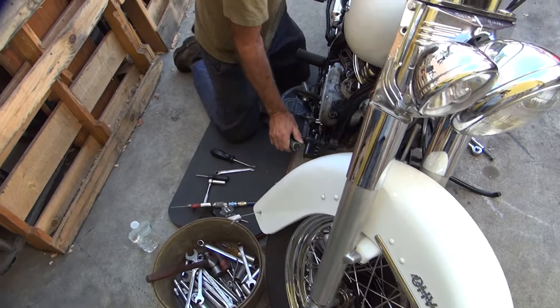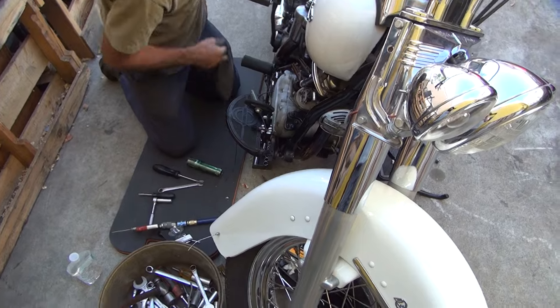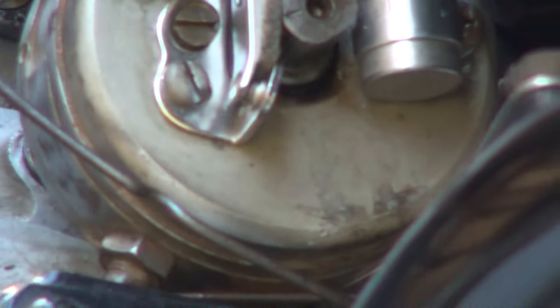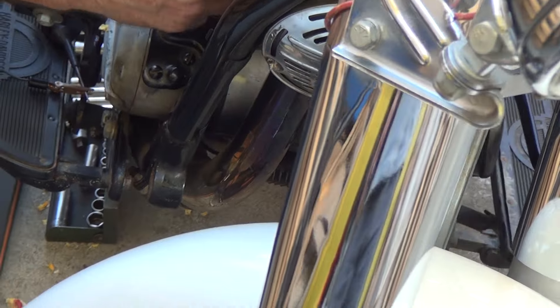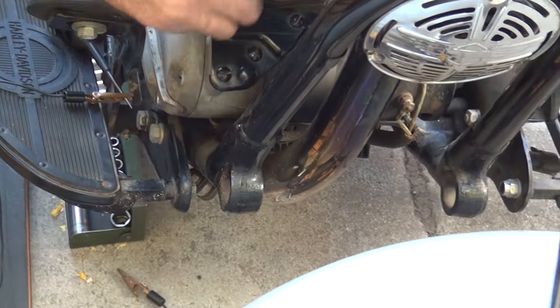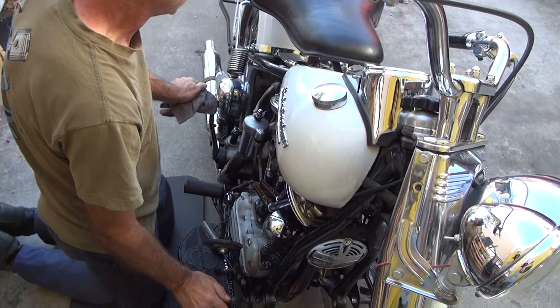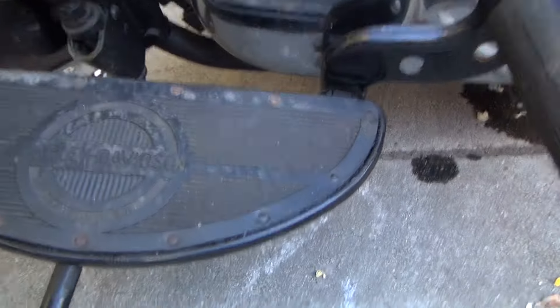I'm going to put the strap up on the top of the tube. You've got to put this thing around. You've got to put that on there — we're gonna turn it over and see. Make sure the condenser wire doesn't get any pinch. Put that on there, put that back up — the advance-retard deal. Now we can spin around until I see that pop. Right there — it's popped. Okay, now that's where it's firing at now. I hope it's in the same spot.